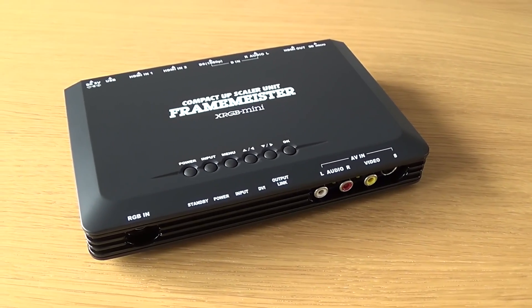Now for HDMI output — actually I should have started with this one. For the cleanest and crispest picture, just put it to 1080p. This is a PAL machine, so I choose the 50Hz option. If you have an NTSC machine, choose the one that says 60 at the end. We want P for progressive, not I for interlaced. Choose that one.